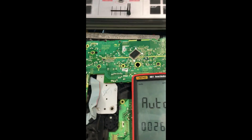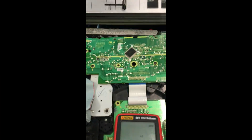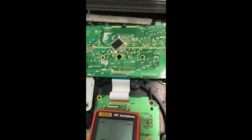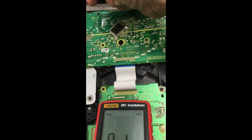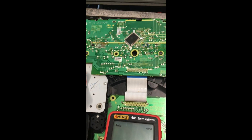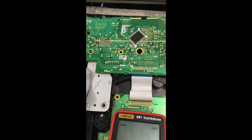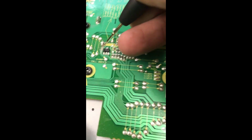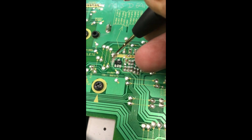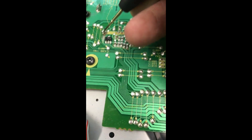So we're back again. I know from previous experience, this line represents the connections on the back of the main display. I just inspected them with a magnifying glass — they're all fine, except for this one, as you can see. See that? That means the trace is disconnected between there and there.